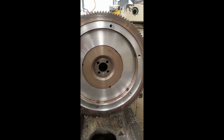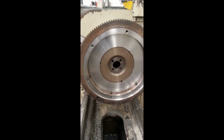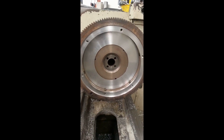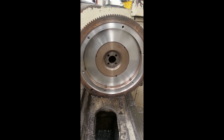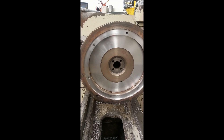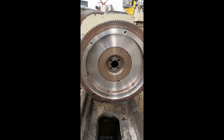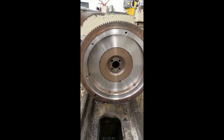What can we take from this? There's no disputing that Blanchard grinding is the way to do this — the surface finish is much better than what I can achieve on the lathe. However, as we saw, Blanchard grinding if not done properly will leave hard spots on the flywheel which will rapidly wear out your clutch.